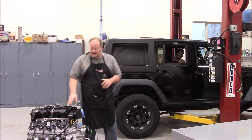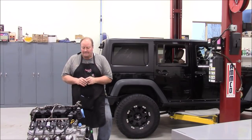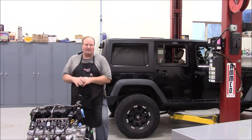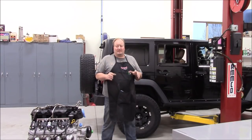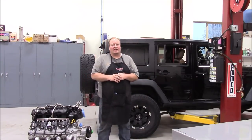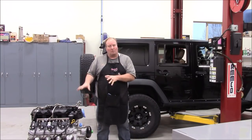The tune will be pretty much stock, tweaked just a little to firm up the shifts and bump a few horsepower, putting it right with the LS3 but with lower RPM torque. The taller truck manifolds do make it a little more problematic getting them to fit under the hood — I'm just running the factory JK hood, so it will be a little tighter than the LS3. But I really wanted the low-end torque and idle smoothness of the truck/SUV engine versus the LS3.